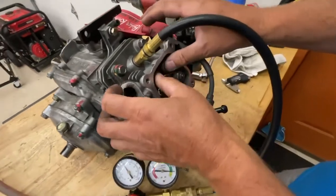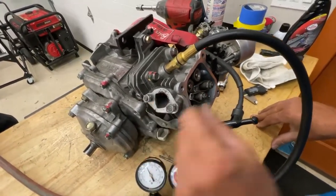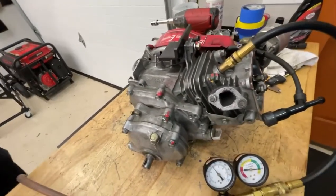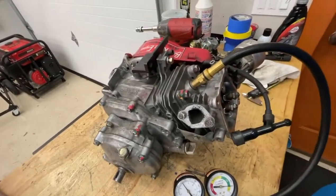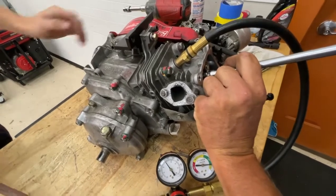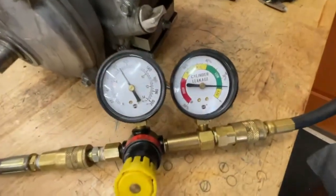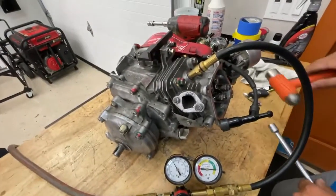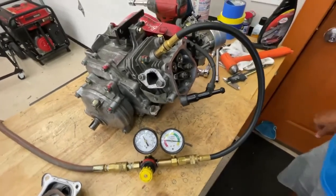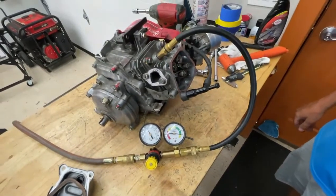Make sure you take the pressure off of the valves, because if it's got pressure, the valve could be cracked a little bit. If you have a leaky valve and you want to see how bad it's leaking, you can sometimes reseat the valve. It didn't change any — it's probably gotten hot a lot of times. That pretty much concludes our leak down test of this motor. This is a pretty simple tool you can get at any auto parts store or online. Thanks for watching Crybaby videos — give us a thumbs up.